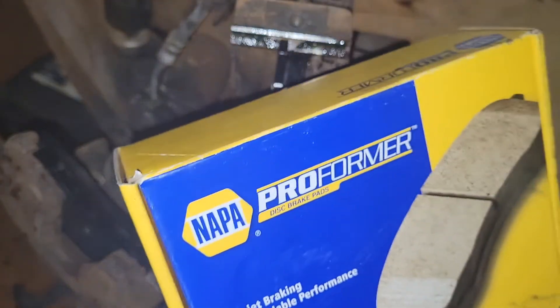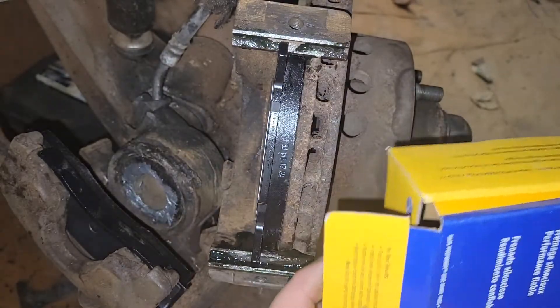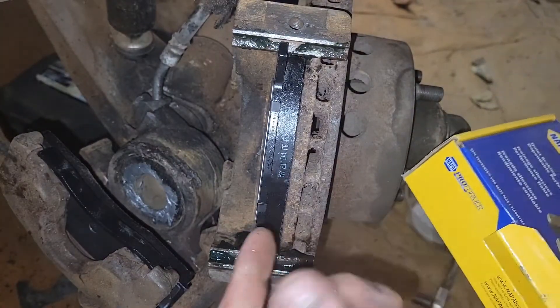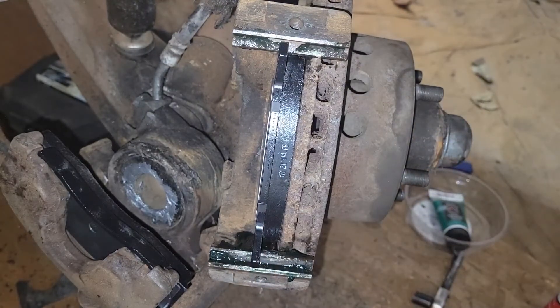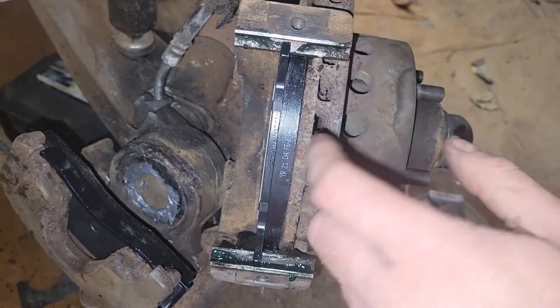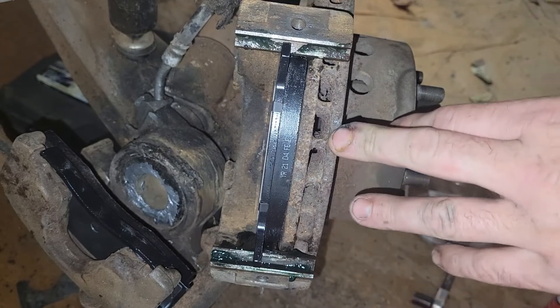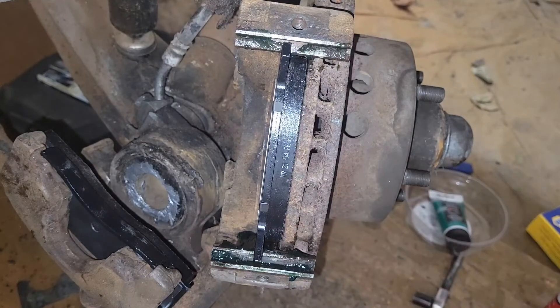Listen, don't go for the high-quality steel-embedded brake pads — they're harder than your rotors, and rotors are more expensive than brake pads. These are only $21 Canadian dollars. In the States that's probably like $12. You can go through a lot of sets of brake pads versus replacing a rotor, so now we're ready to install our brake caliper.